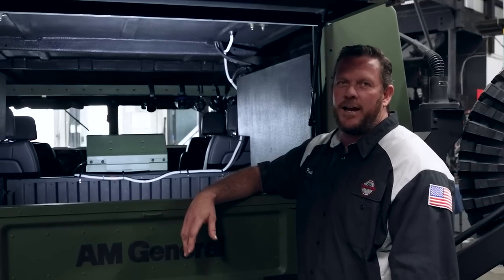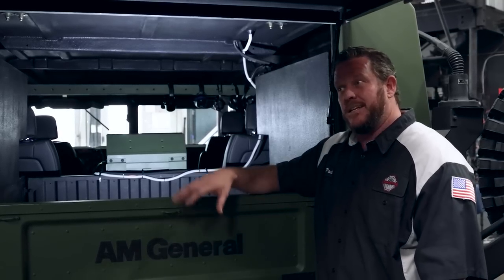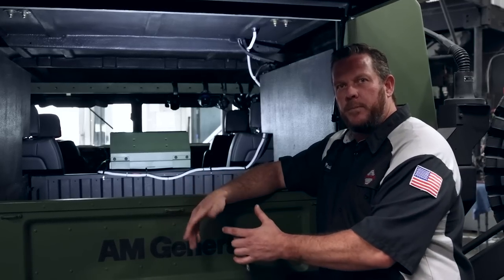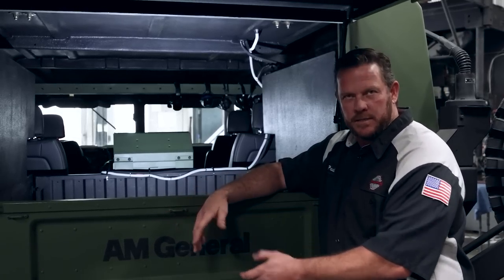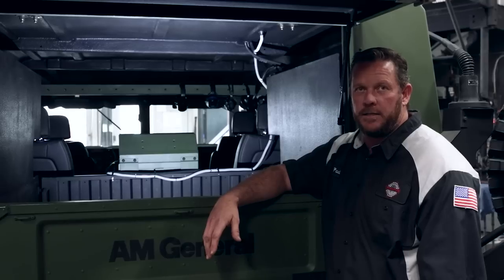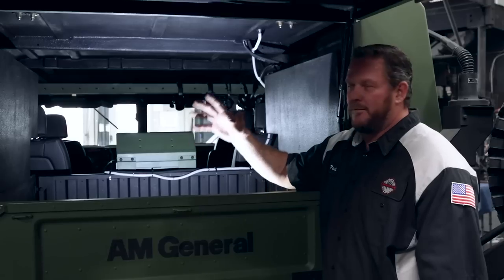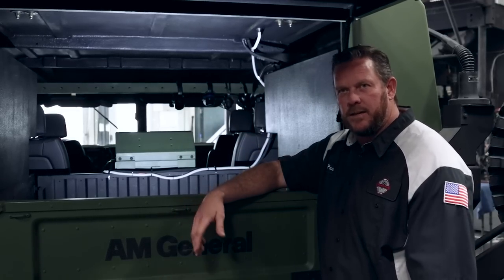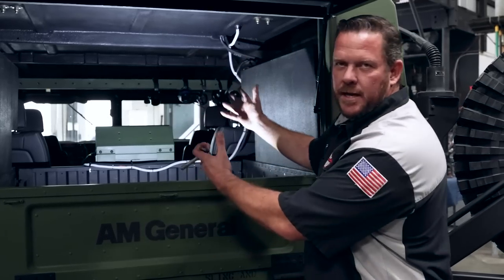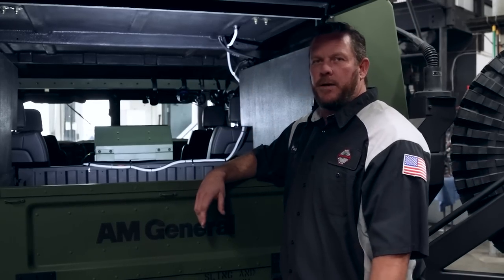I'm on the fence about the Red Dot — it does take up a lot of space: condenser up top, main unit in the back. The M998 is limited on options to hide the ductwork since there's no proper dash. That's where the popularity of our alpha dash kits comes in — you can take a base model Humvee, put in the alpha dash kit with a complementing HVAC system, and hide the ductwork properly. The base model just has that one dash cap with nowhere to run duct. Still, it's nice to have some AC in there.